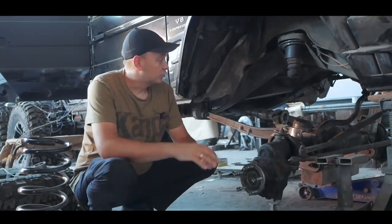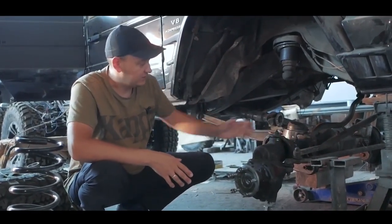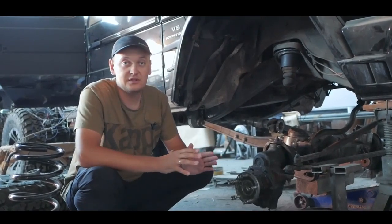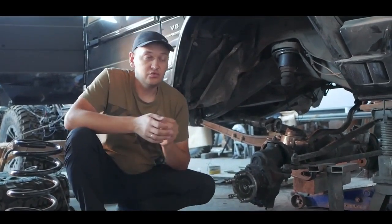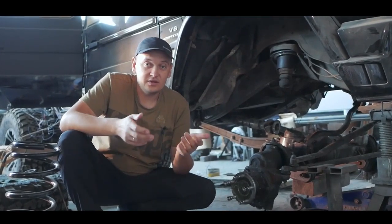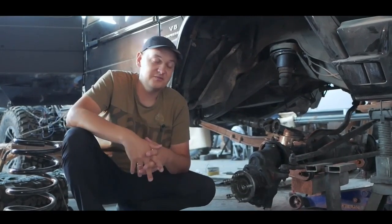I will tell you about our subscriber. He said to me, "Sasha, what do you need? I have the same G-Wagon in my service station." He measured the glass and height. I quickly checked our parameters, and I was impressed: the parameters outside the windows have a difference of 2 mm, and the back window has only 4 mm of difference. He gave us the distance from the ground to the arch, and now we are regulating our wheels.